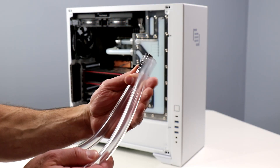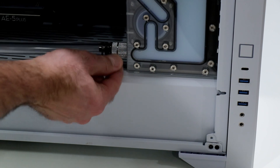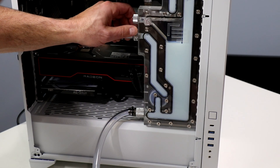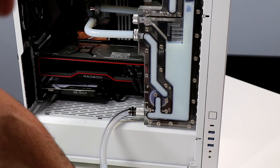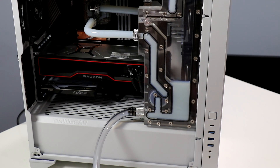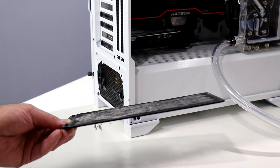Next, we have to drain the lifeblood from her beautiful icy veins with the help of this drain tube. Pulling the plug carefully from the bottom drain port to attach the hose should do the trick. We'll tuck the hose into a bucket and unscrew the fill port cap just a touch to breathe some air into the system. However, this just drained the cooling liquid from the main distribution block, so I needed an extra set of hands to tip the case in various directions to drain liquid from the hard line tubing, radiators, and CPU cooling block. We also remove the PSU intake filter for a quick cleaning.